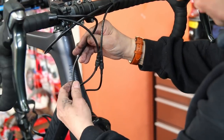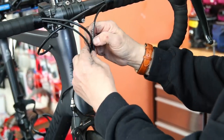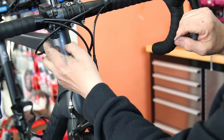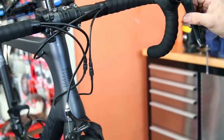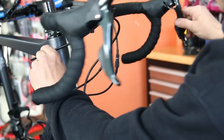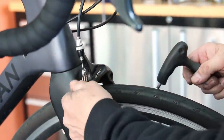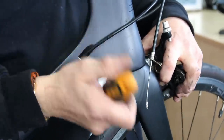Here you can see the front brake cables — we had an issue with them being just a little bit long. This one's fouling the other cables, which I never like with a front brake cable. This other one was quite looped and was catching on a light mount bracket, so you were only getting a short range of steering before that cable was tagging on that bracket. If it were just an inch or so shorter, you'd still get full lock on the steering without catching the bracket. From a safety aspect, I decided to address both these cables, and it was a good job I did, as you'll see as we go on.